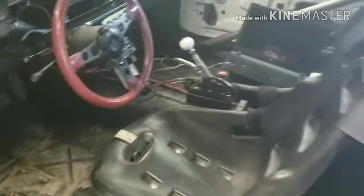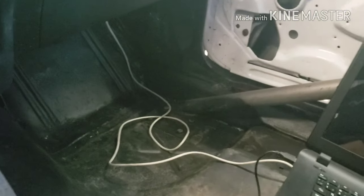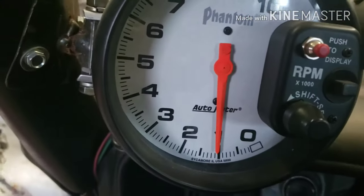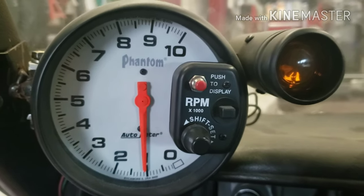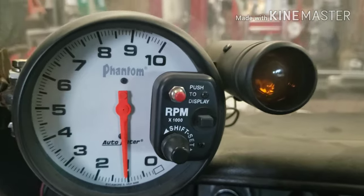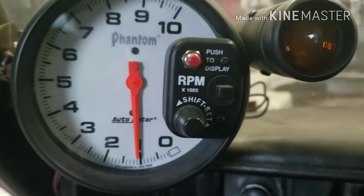Brought the car into the shop today after work, got the computer hooked up, ran the cords. Moved the rev limiter all the way up to 7200 so I know I'm not gonna hit it. Put her in first gear, held that little button down after the car was warm, held the throttle right to the floor — this thing came up to 5500 RPM. I'm shifting at 5800, the converter stalling at 5500. That's not working very efficiently. I'm gonna have to switch converters — I do have a couple others I can try.